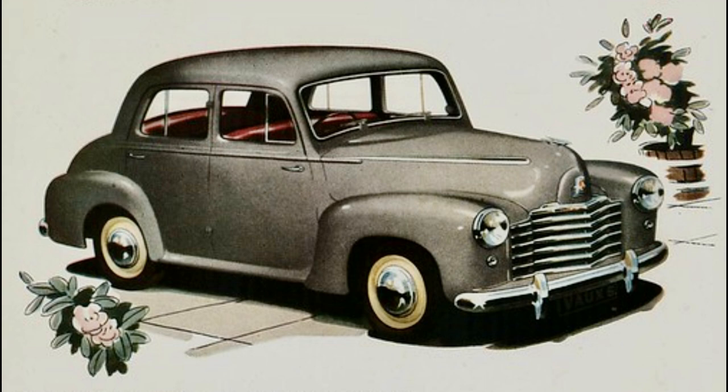There were only 3 forward gears, and it was not very fast, but we did a lot of miles in it. We took it down to Cornwall. However, when returning to Malvern, disaster struck. Unless it was for mechanical reasons, I rarely stopped on a journey, but Rosalind saw a cafe and wanted to pause for tea. We'd overshot it, so slightly irritated, I selected reverse gear and let in the clutch before the car had come to a complete stop. There was a bang, and we had broken a half shaft.